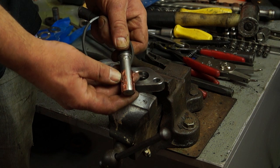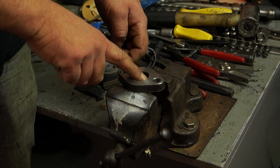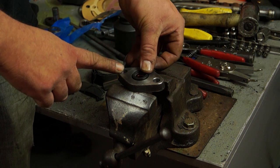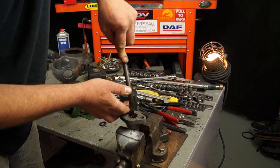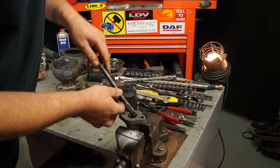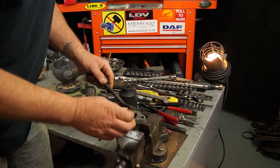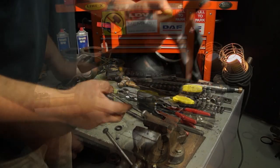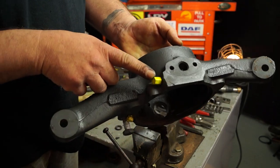The copper holder is for holding the ABS sensor in place — once you've pushed it in, that will locate it and keep it there. It needs to be pushed into the top peg first, and then you can put your seal on. If for any reason you're going to reuse the top pin, you'll want to get the ABS sensor bracket or holder out and replace it. That's easily done by just prying it up with a screwdriver. Even if you replace an ABS sensor, you want to do the same thing — get rid of the old one and put a fresh one in.